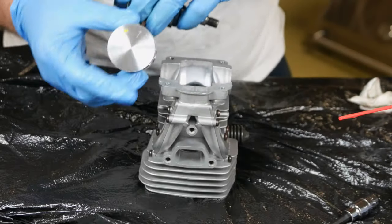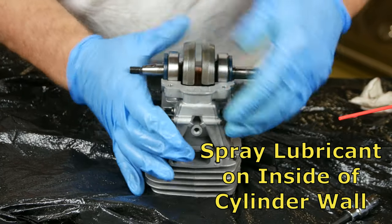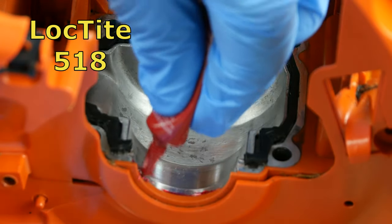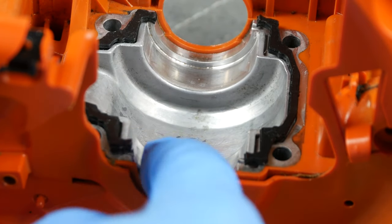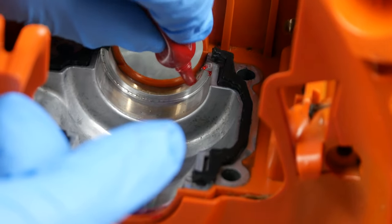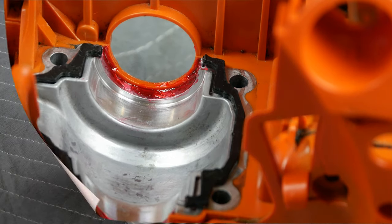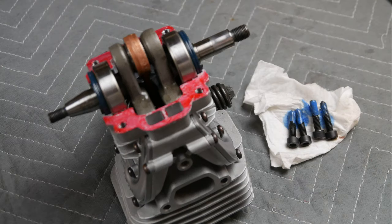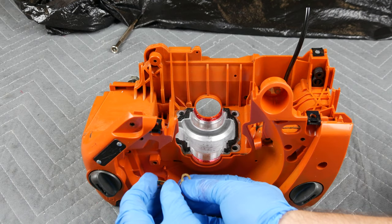Using the arrow on top of the piston as a guide, line it up with the exhaust port on the cylinder as you reassemble. The bottom of the cylinder is tapered wide enough to insert the piston and ring without compression tools. Next, lay down a small bead of sealant on both ends of the case where the crankshaft bearings will sit, then take your finger and smooth out the bead. Clean off any excess sealant. Cover the bottom of the cylinder with sealant and place blue thread lock on the four cylinder bolts. Now don't forget to reinsert the grounding strap, as one of the cylinder bolts goes through one end of the strap to secure it in place.